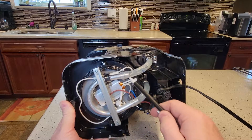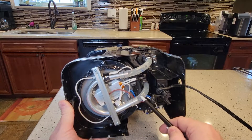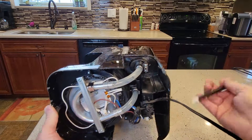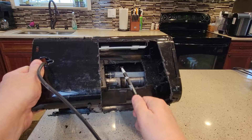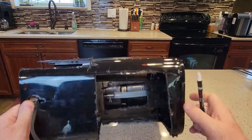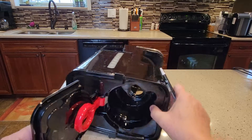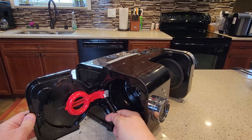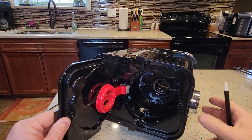On the bottom of the coffee maker it has this heating element. This horseshoe shape is what heats up the water. Water comes in here, gets heated up to a steam — real boil, real hot — and gets shot out this tube. If you follow it, this tube is inside another chamber that comes up to the bottom of the brew head, and that's where your hot water comes out to go on top of your coffee.